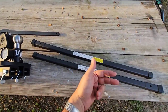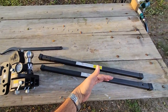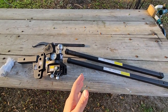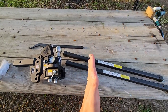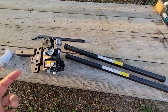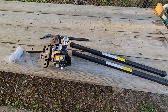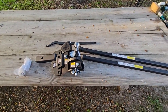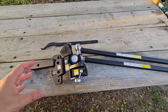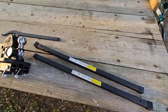As that pressure pushes down, that's your sway control. You'll have sway control right here in the hitch head and also from this downward pressure on the L-brackets. The weight you apply for weight distribution also creates friction for sway control — that friction prevents the truck and trailer from hinging. When wind hits, it doesn't hinge right at the center where the hitch is; this pressure creates friction that makes the truck and trailer track together. This works in a similar fashion to many other weight distribution hitches, with friction at the hitch head and on the L-brackets.